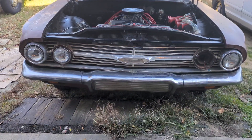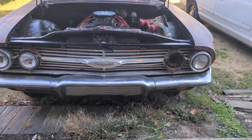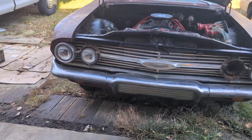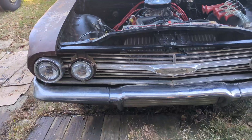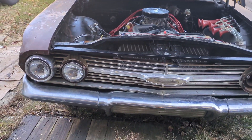It needs a couple other things, but right now we're just focusing on high beams. The high beam lights are those center lights — the one that's out on the left side and the one on the right side without the trim ring. Those are the high beam lights and they're separate from the other lights in a typical 4-light setup system that you had in older cars.